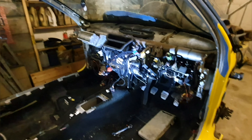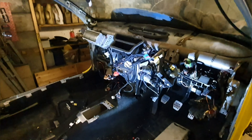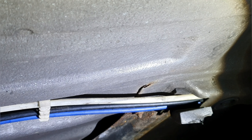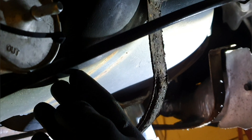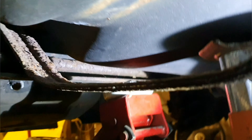Right, so that's everything in the car done, so we're now going to move to the underside of the car and start by taking the fuel tank out and removing the fuel lines. As you can see, I've disconnected the fuel lines there and what I'm doing now is just unclipping them from these brackets — one bracket there, one bracket there — and then they go into the chassis to the engine bay, it's just a case of pulling them through. I've taken the cover off to access where the fuel pump is, disconnected the electrics to that, so that should all come down in one piece. I've undone these two front bolts for the brackets, and slowly but surely it's coming out. I'm going to undo the rear two brackets and see if I can wiggle this out.